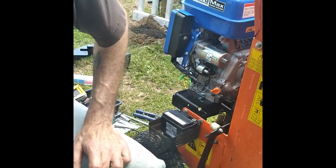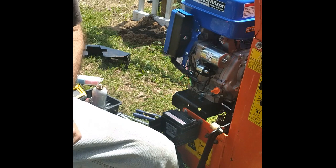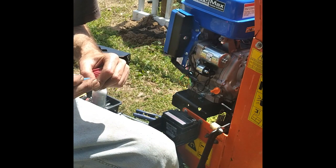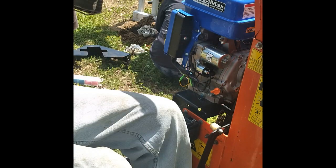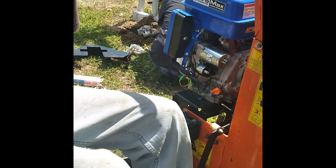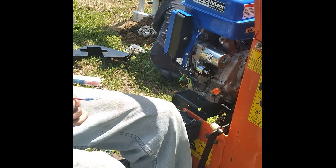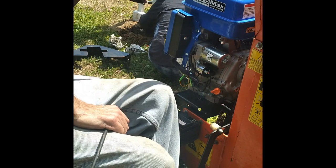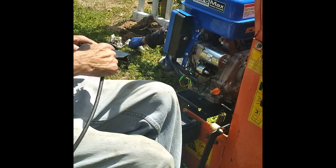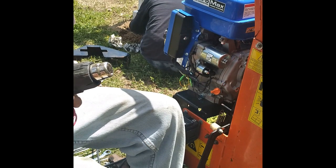I'm just using a 14 gauge wire. You're just going to strip off a little bit off the end there. Using a quarter inch ring terminal for the solenoid side. It's always a good idea to get the good crimp on it — if it strips right off, it ain't right. Since these already have a piece of heat shrink on them, let's shrink it down a little bit. It's a good idea to put a new shrink on there — keeps it sealed up, keeps the corrosion out, keeps it tight.